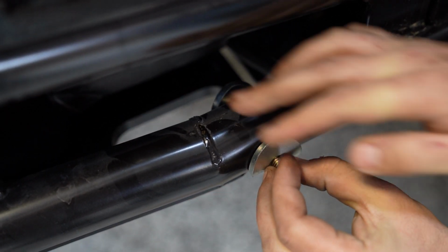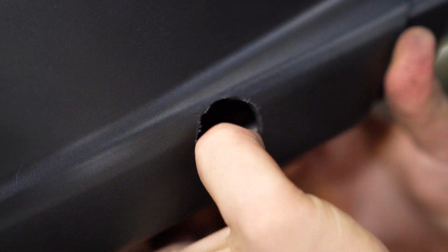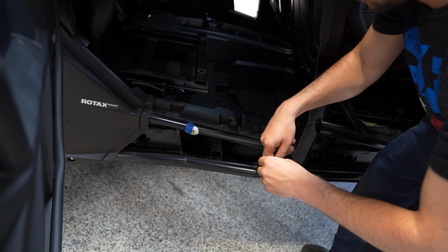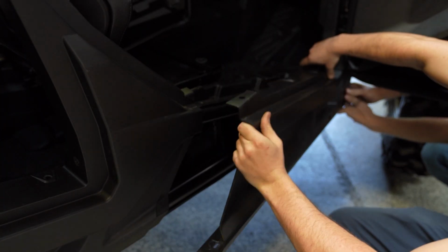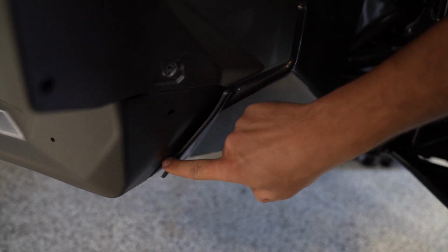Install all 3/8 bolts and curved washers in this order, starting from the back side of the frame: bolt, washer, frame, washer, Nerf bar. Now it's time to slide your plastics back into position. Be careful to not push the bolts back through the frame. Don't install the hardware for your panels just yet. Leave your plastic hardware panel out for now.